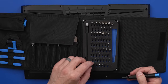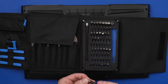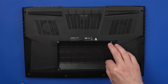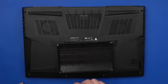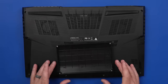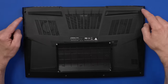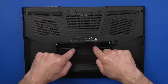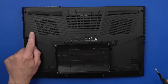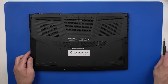I think we need a Phillips. We'll try a Phillips 0 — a little small — go with a Phillips number one, much better. In order to keep these screws straight as to how they go, I'm actually going to put a screw right up on the tray in its approximate position, so I'll know where each one goes when I put the cover back on. I'll put the side screws here, the next screws over here, and the top ones up here.